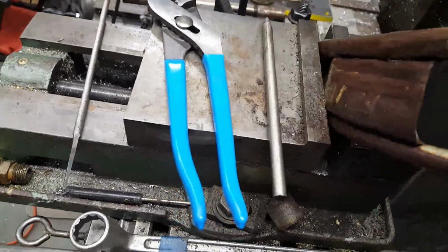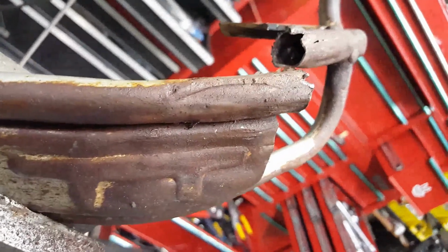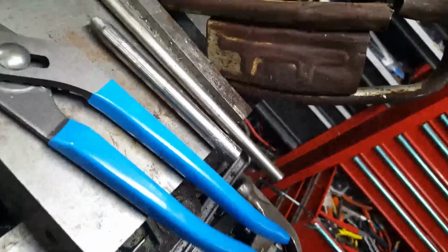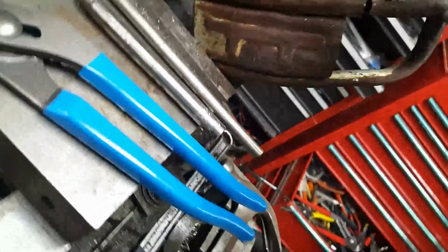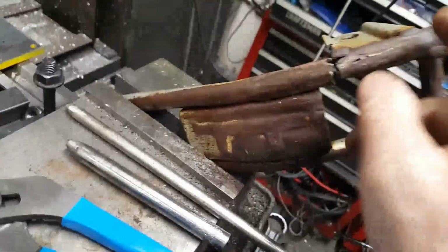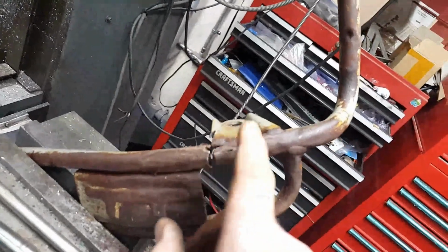And this goes in there now. And that side is semi-round. And this side right here is pretty much done. I mean, all I got to do literally is bend this back around to where they join up. I may end up having to cut a piece of steel to get those together. But when I get it on the quad, I'll get the holes all bolted into it, and I'll beat these things down until they're pretty close, then I'll weld them.